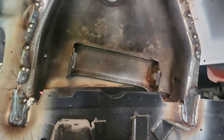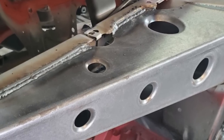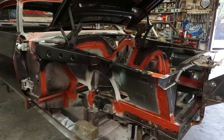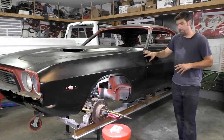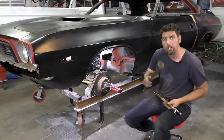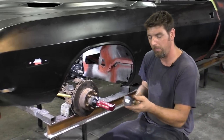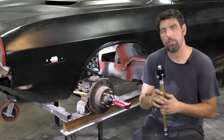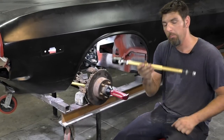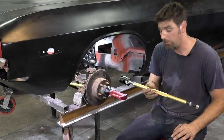Another thing about welding - you don't have to lay dimes when you're MIG welding. A simple run-down pass with the welding should look like these pictures and just flow real easy - it looks like most factory welds. When you're running the dimes, you're putting excess heat and there's no need for it. If you want to run dimes, start a TIG welder. Now I'm going to go over the front suspension one more time. The strut rods were bent, so here's our replacement - this is a QA1 adjustable rod, and it pretty much bolts into place. We set this car up with factory settings in case someone wants to go back to a factory rod. But these QA1s - if you have one of these cars and can't get caster and want to adjust it without caring about a 100% factory look - they look like a very good product.